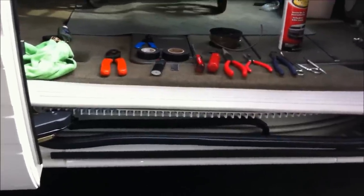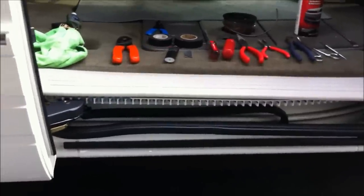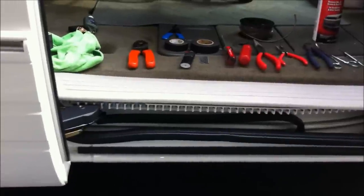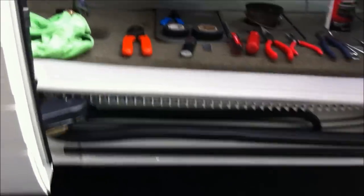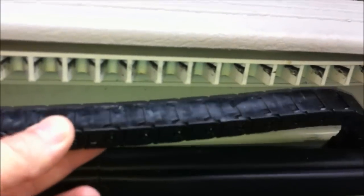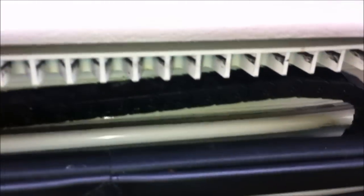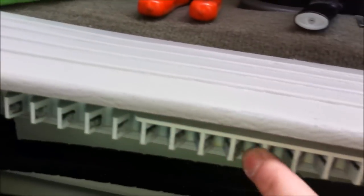This is my first YouTube video, hoping it helps people with their Chrysler. Auto opening doors tend to have problems with the wiring that goes to the door. If you look closely as I bring it in, you'll see this little track right here — it's a plastic link that keeps the wiring inside and is designed to help roll the wiring back and forth.